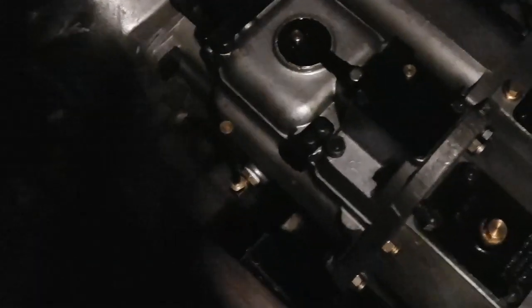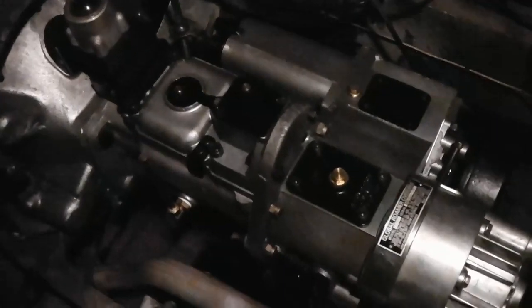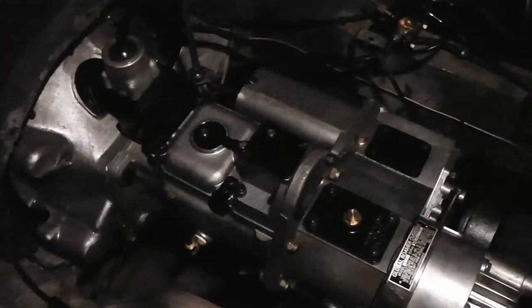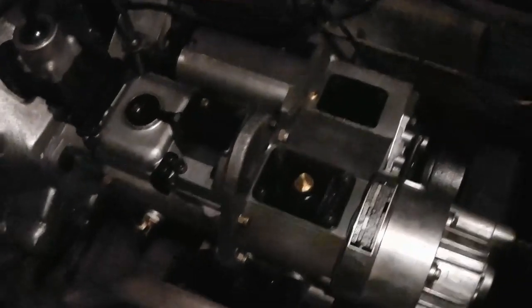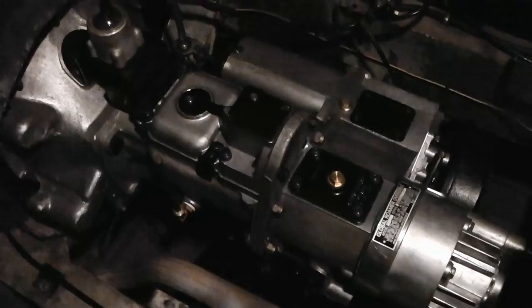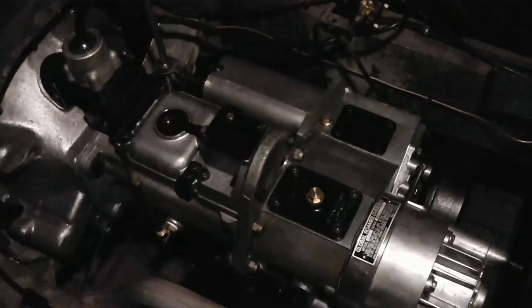There are a few things that cause that - the springs in the synchroniser hub for third and fourth will be tight, and the first and second synchroniser is a lot tighter on this one. You've got nice new heavy detent springs in the top and they do actually squash down a bit over time. But it all works and it's not leaking oil, so I think we will actually be good to go. Just to finish - it is improving. I couldn't actually select any gears when I first put the gear selector lever on, but now with it stationary I can just about do that. So just for a short run like that it has actually started to free everything up. I've had a look around and no oil leaks, so that's a bit of a result.